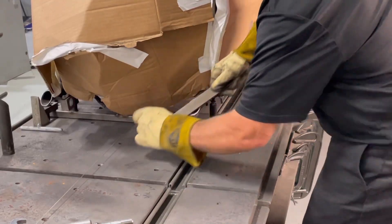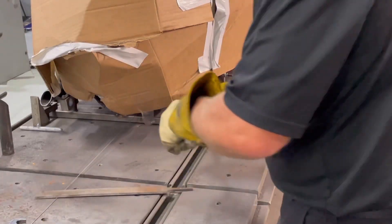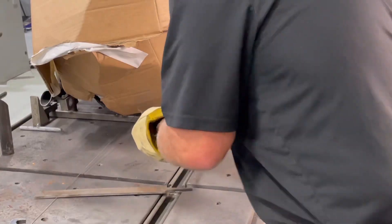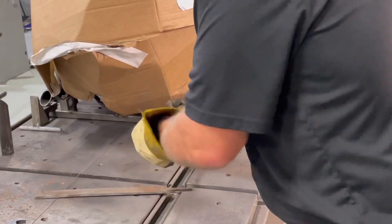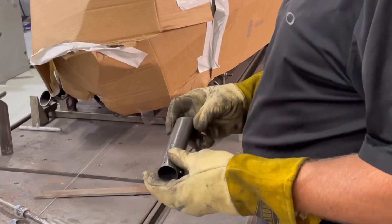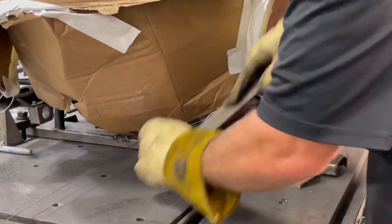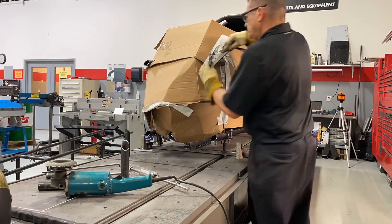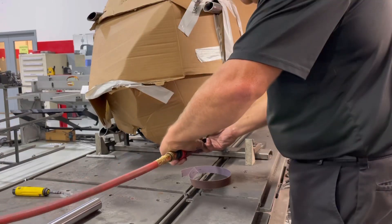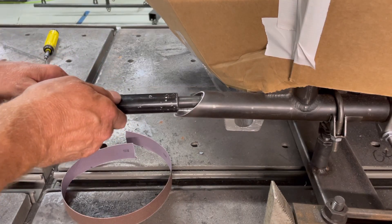So I'm going to go ahead and get this thing sanded down. We're going to do the same thing like we did on the other horn on the other side, get it back as far as we can. This one I've got to take back just a little bit farther to get all this contamination off this pipe before I try and weld another pipe to it. To the normal person, you don't see how much work has to go into these chassis just getting them prepped — let alone cut the damn thing off, get it lined up right, have all the tools ready. It's a real pain in the ass and it's time-consuming as hell. Once I get this one out, I'll go to the other horns, do the same thing, finalize the angle on them, make sure it's nice and square. Then you've got to go to the inside of all these tubes — when these uprights and everything are welded on there, it will protrude through a little bit. When you go to slip the new piece inside, it ain't going to fit. It's got a couple thousand tolerance where this thing goes in there.